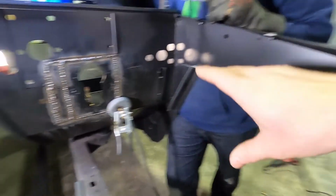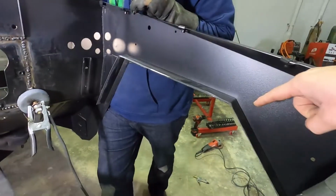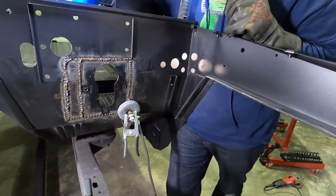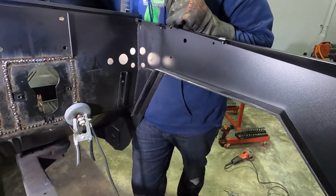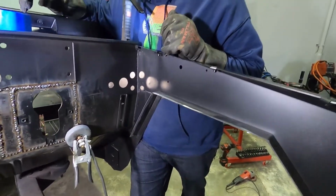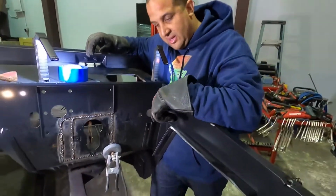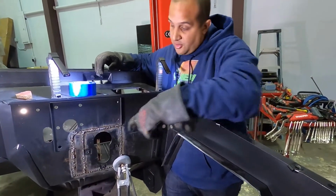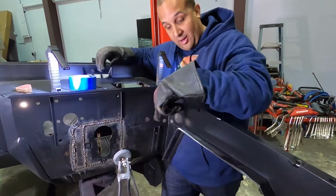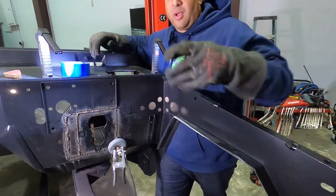So what we did here and what we did on this fender, you can do on your Bronco at home in your garage to get it prepped for doing a Coyote swap. I know a lot of guys cut these things, they'll actually cut a section, 1.5 inches out of it. So then you're doing all of this back on that wheel well and then Bondoing, finishing.